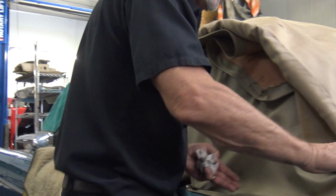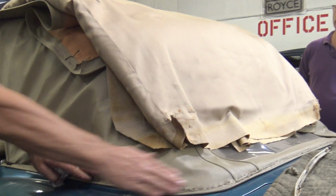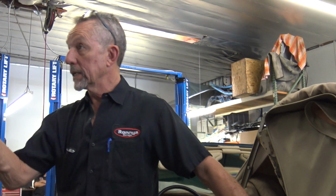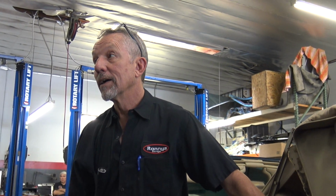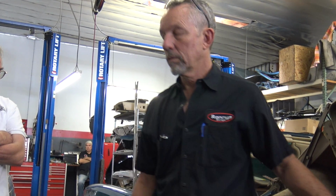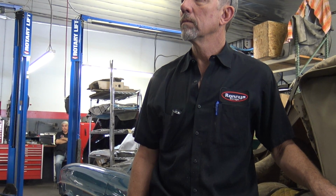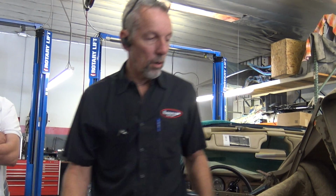Yes. Especially when you're talking about, okay, it's got to go this way, then it's got to twist and go this way, and then it's got to lay perfect, right? You can anneal it. Okay, but that's still metallurgy, right? It's not easy. No, I'm just heating it up and then quenching it. It's the opposite. Typically you harden steel by heating it up and quenching it. Right. But with brass, it works the other way around. Well, copper, it works the other way around. If you heat it up and let it cool down gently, it'll harden. But if you want to keep it soft, you can quench it. Oh, really? Yes. So, okay.